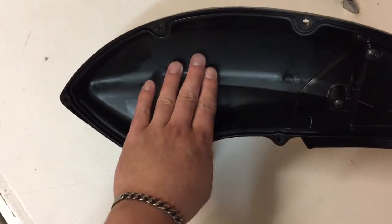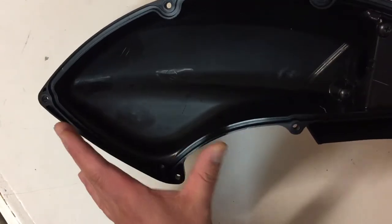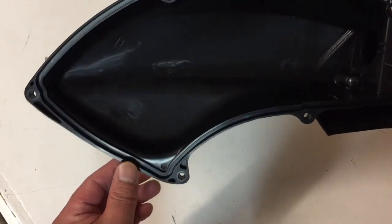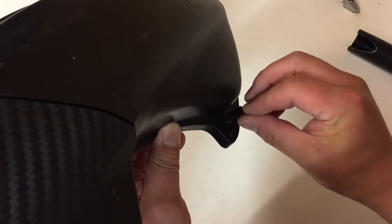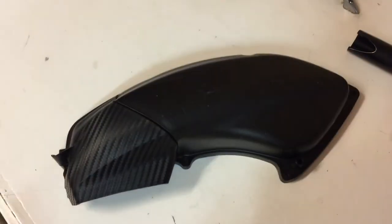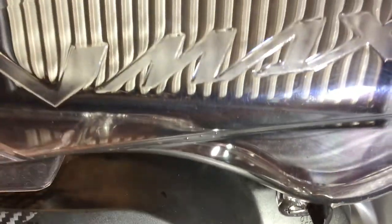This empty sloped part is specifically designed to allow moisture and dirt to hit there and then dribble down. This part is designed like a cup to hold moisture, dirt, or debris in that section. If you look very closely, right in the bottom there is a hole, and on the other side there is a plastic nipple connected to it. Any moisture that's been collected there — you just squeeze the nipple, it creates an opening, and all the moisture comes out. Here's the nipple on the actual air box — just squeeze it and the moisture drains out. That's the design of the air box — pretty ingenious.